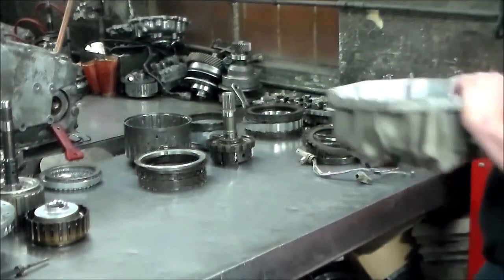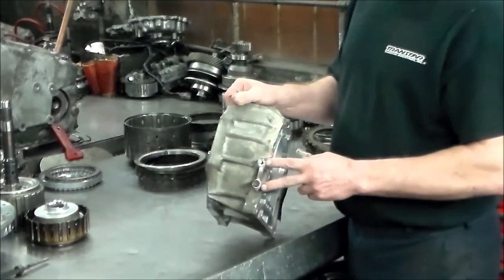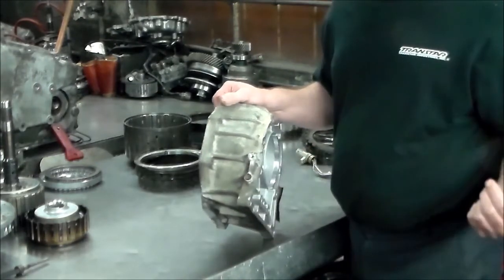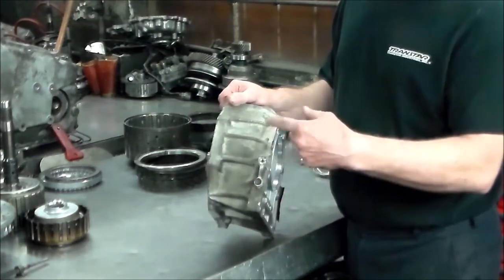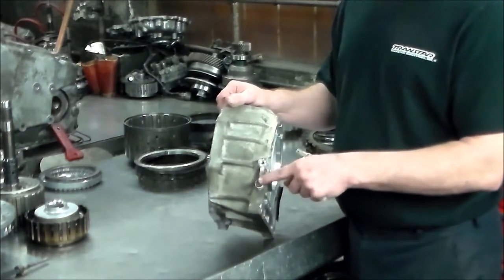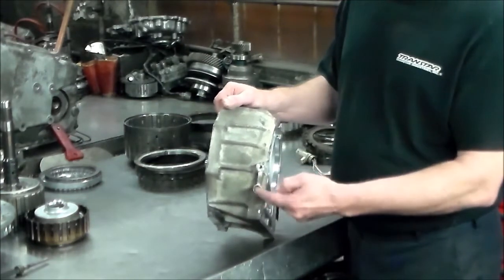And here is the tail housing. Of course, your transfer case will bolt to here. You got a couple of linkage bolts here that get weathered like the pan, but this one was okay. This one broke, but I managed to drill this out perfectly center, keep drilling it larger and larger, and it got to the point where I can see the original threads. This is 8x1.25, I ran it through, and I saved the original threads and put a bolt in it.